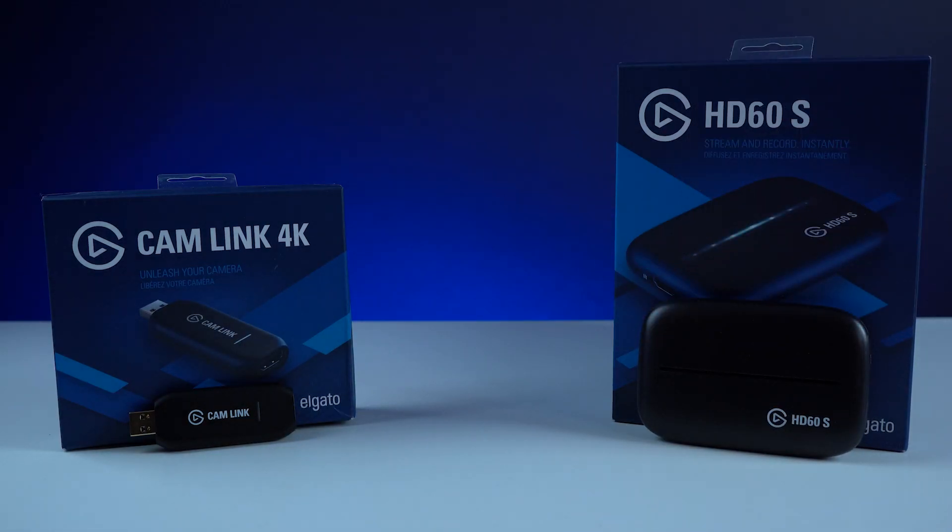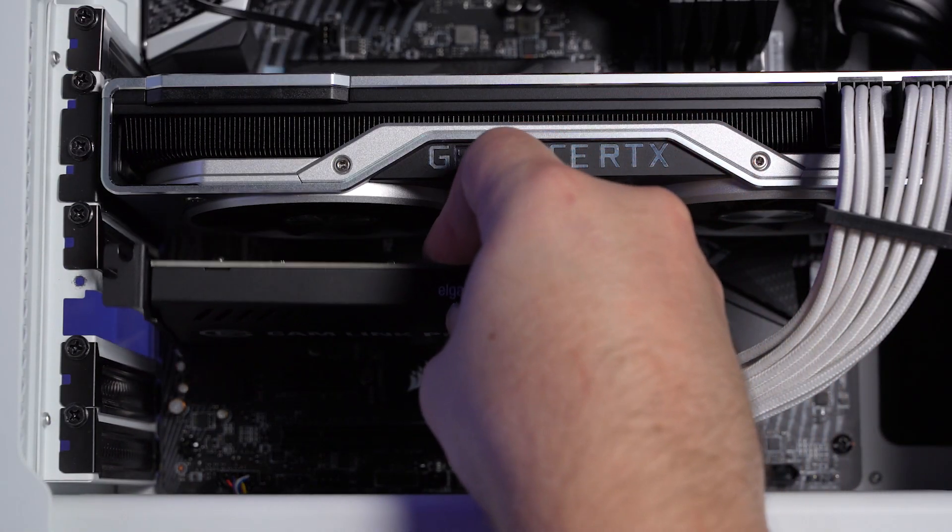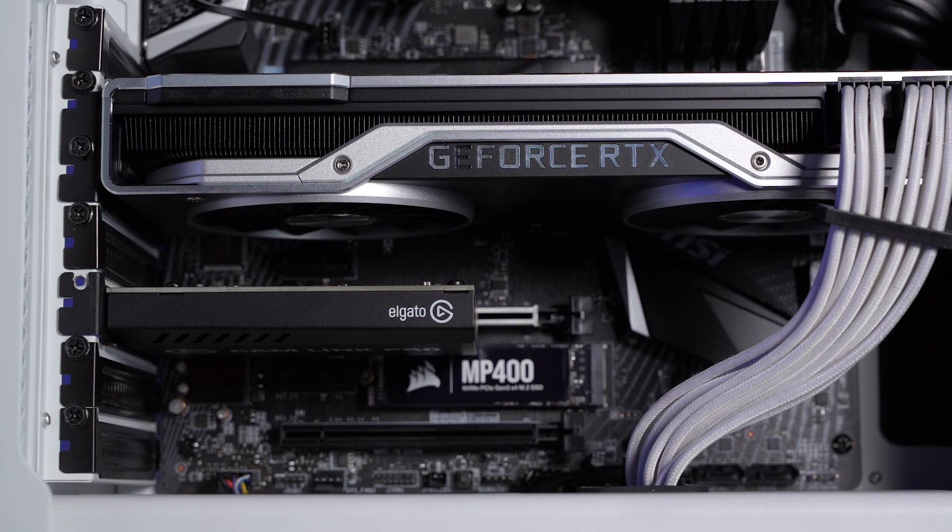It's because it's either not getting enough power or bandwidth to properly perform. A lot of USB 3 devices don't use the full bandwidth of the USB 3 spec. However, things like webcams and capture cards like Cam Link are high bandwidth devices that are also real-time performance devices. So with these devices especially, you want to make sure they're on different controllers so you don't run into these issues. With the rule of thumb of one high bandwidth device per USB controller, most setups can use at least one or two capture cards, webcams, or Cam Links and be perfectly fine. But when you go beyond that, or your setup has other high bandwidth devices, you'll start to run into issues of finding the best ports to plug your devices into. This is where internal capture cards are so convenient, because they plug directly into your motherboard via PCIe lanes, which have a ton more bandwidth than USB, so they aren't susceptible to these USB quirks. They avoid the issue completely and just offer a more stable experience in production.